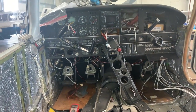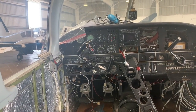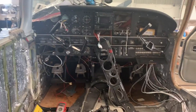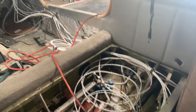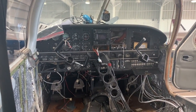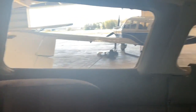Cleaned it up, got the wiring out, and of course it ran all the way from in the back up to the front, and now we have to fix the pitch trim on the yoke because it's all hooked in totally differently with this autopilot, so we got some more soldering to do. Oh boy, that was unpleasant. Okay, now next is I think just finishing up the wiring and under the dash stuff, and then we can start mounting servos out on the wings. Sweet. All right,